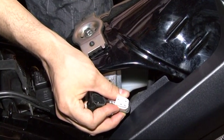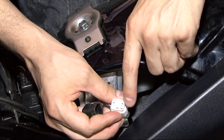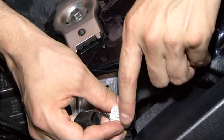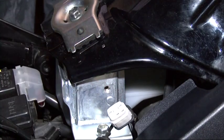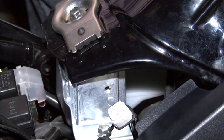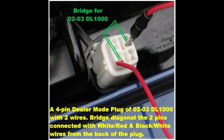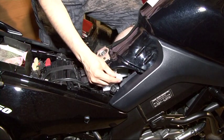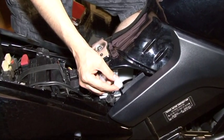You open it and bridge the two pins which are one above the other on one side. I will show you how to do this to enter dealer mode. The 2002-2003 DL1000 has a 4-pin plug with only 2 wires, while this one has a 6-pin with 4 wires.